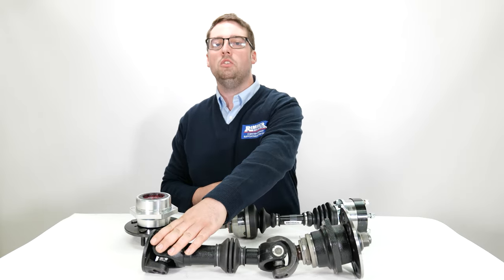As you can see it's a little bit fiddly but we'll go around and do all the other four. As you can see we've nipped up all the nuts — we've just got to tighten them up. Unfortunately we can't put a torque wrench in so we're just going to give it at least a couple of grunts. We've tightened up the nuts on the inboard universal joint. We just need to fold back this rubber protective gaiter to cover it — if I gently turn it and fold it it should go back to where it was.